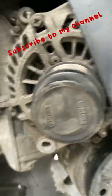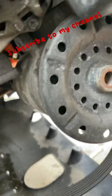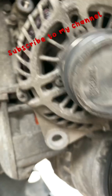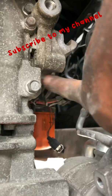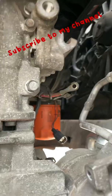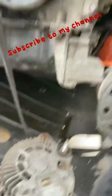Okay, I figured out how to get it out. It's not all the way out yet, but this is the angle you want to do. Go to the air compressor, pull it down enough where you can slide it out of here like this. I was about to move the alternator bracket, bottom bolt bracket. I didn't think it was enough room, but as you see, I was about to move those two bolts right there and right there. But it is enough room to get it out with the bracket still in there. As you see, the alternator's laying right there. Waiting on her to bring the new one.